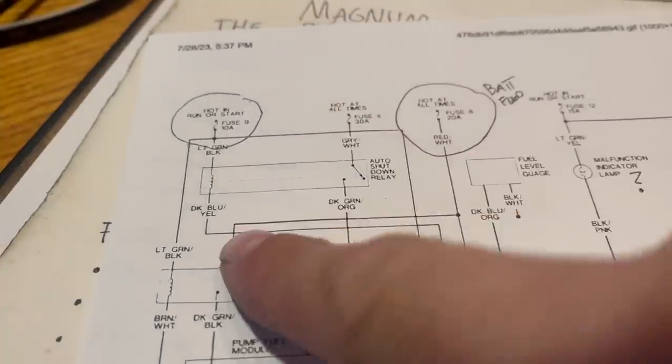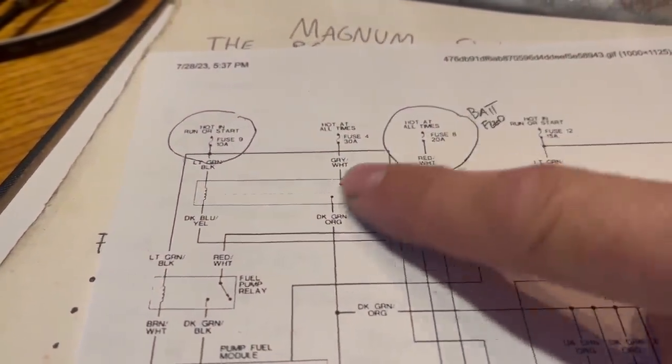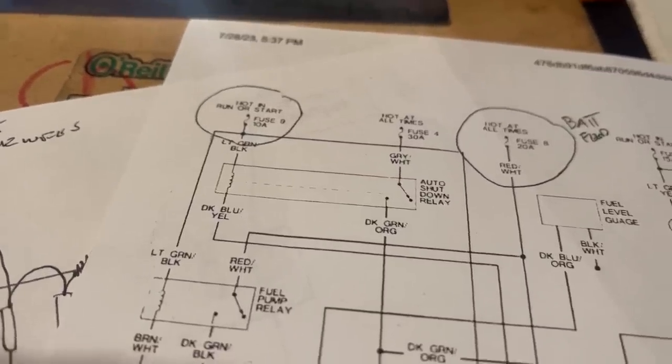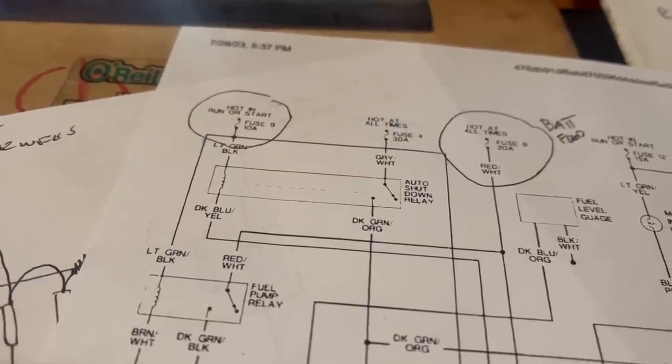You can see here the coil side. These are the wires that control the relay, and the connection side. This is where the switching happens. The relays we're dealing with here are standard 4-pin relays. They could be 5-pin relays, but the 5th pin wouldn't be doing anything, so we'll just assume they aren't.